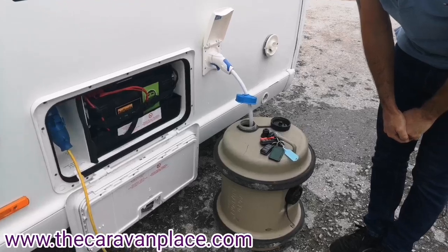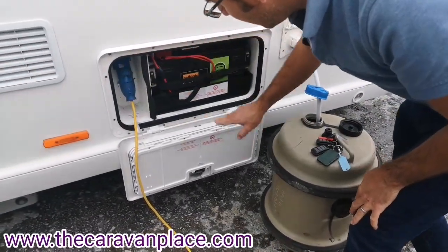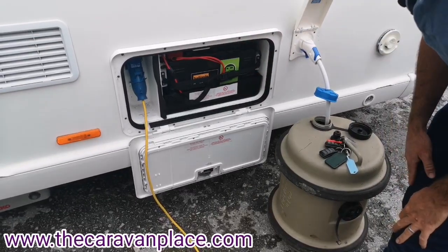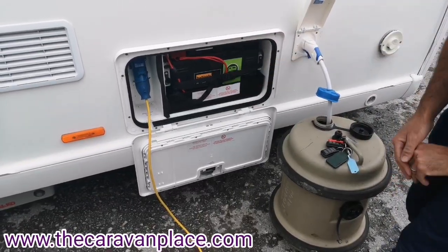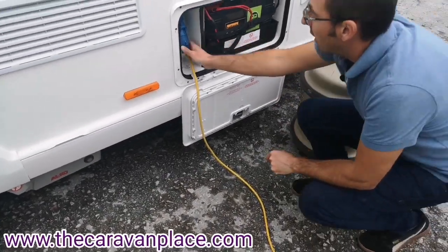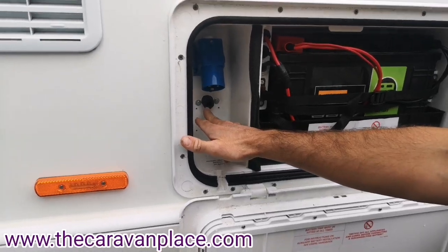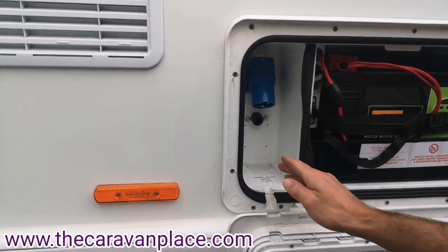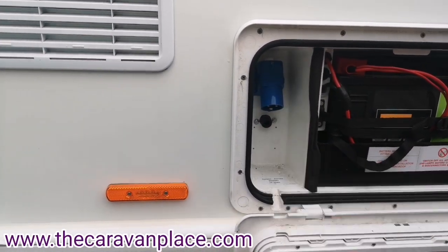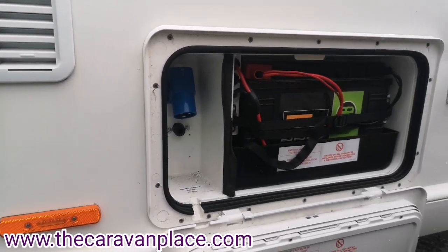We've then got our electric locker, so our 230 volt plugs in, and our battery connects. Again, roughly 110 amp battery, leisure battery this will take. Just hidden behind our electric socket is the isolator switch for our motor mover. So again, this is how we turn the power on to the actual motor mover when we're using that.